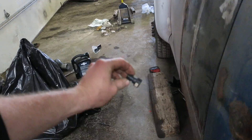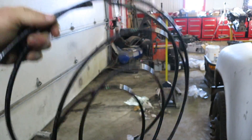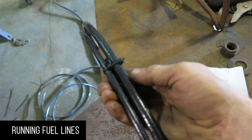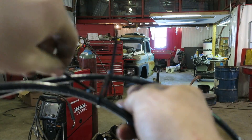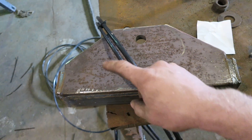The fuel tank is mounted and we've got to run some lines. You can pick up these cheap little fittings with O-rings on the inside, and I just use airline tubing — it's coated on the inside with Teflon. Never had an issue; I've been running this stuff in my truck for like 10 years. For poor man's spacing of the lines, just a zip tie around both and then a zip tie in between works really, really well. Run it in line with a couple tech clamps — keeps the lines spaced nicely all the way along. Works good for spark plug wires, brake lines, whatever you want.